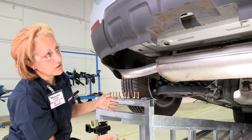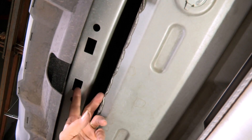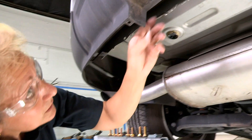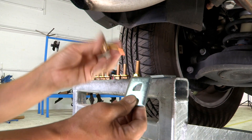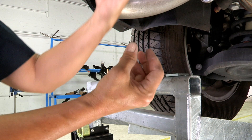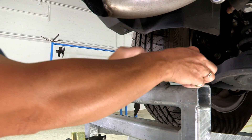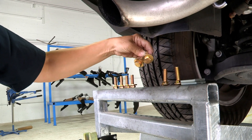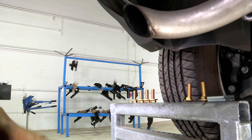This vehicle has two different options. On this particular vehicle it's going to have the feed option where we have to feed the bolt down through the frame. We're going to run it down through and pull the bolt down, which means we're going to use this option with the plate and the bolt. The bolt fits down in here and locks into position. That means this vehicle is going to have some extra bolts — you'll have two that aren't going to be used. You will need the remaining ones to put in on both sides, left and right.